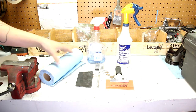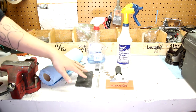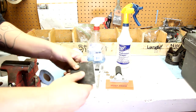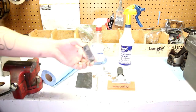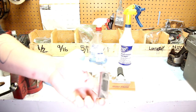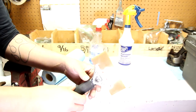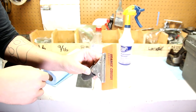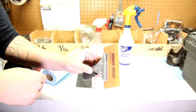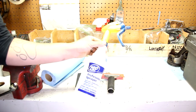The things you're going to need to complete this job are some lint-free paper towels, some spray to clean down the windshield or window, a hard card to push the bubbles out, a razor blade or exacto knife to remove all the gunk, fingerprints, and oils off the surface. You'll also need a squeegee to push out bubbles and help grip down on the surface, and a water bottle with dish soap and water to adhere the tint.